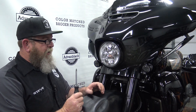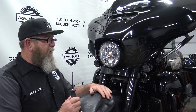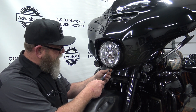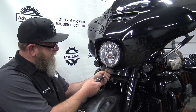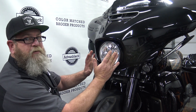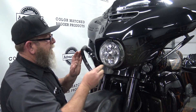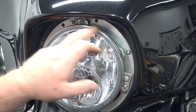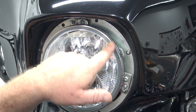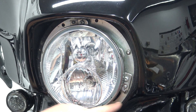Taking your old headlight out is very simple. Make sure to protect your front fender so you don't have anything coming down and hitting it. Right down here at the bottom of your beauty ring you'll see a Phillips head screw — we're just going to take this out and set it to the side because we are going to reuse it. Once you have the screw out, grab the bezel and twist it counterclockwise until it comes off. Now inside the headlight bezel you have several different screws, and you want to make sure you take out the right ones — you just want to take off the ring.